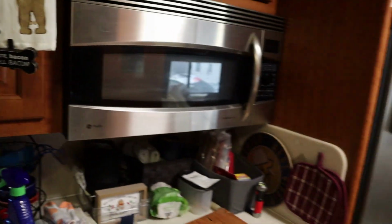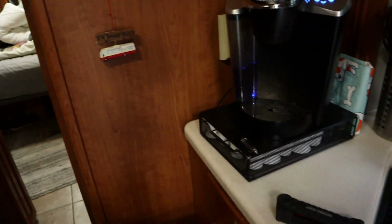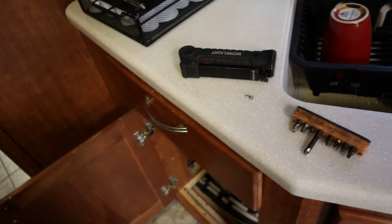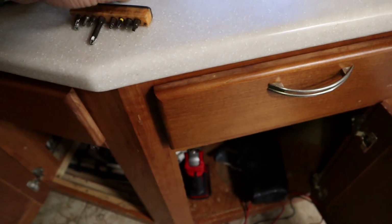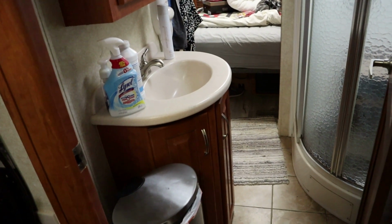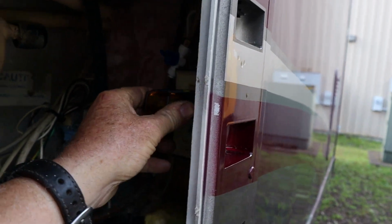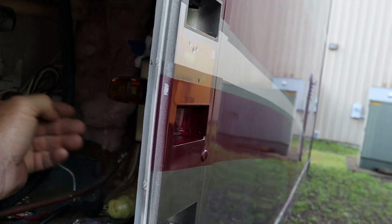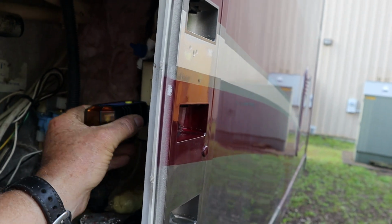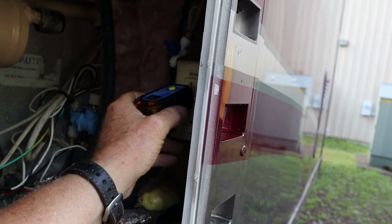So the refrigerator outlets don't have power, and the water heater has a short. Now I wonder if we just took care of that short, because those wires were smashed pretty hard. I may go back here and throw the breaker on that water heater just to see. Let's see if it's restored our power up here. No, of course not. Why would it, right? Yeah, nothing. Getting no lights on my tester here.